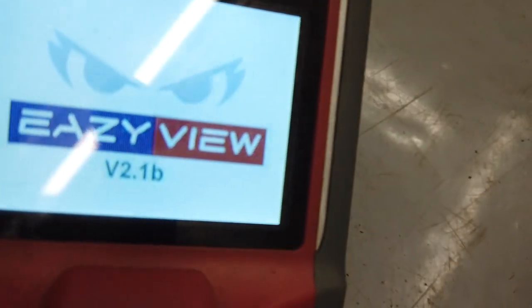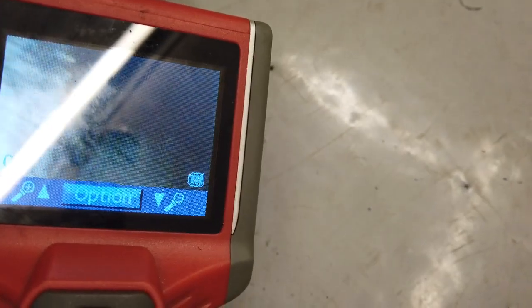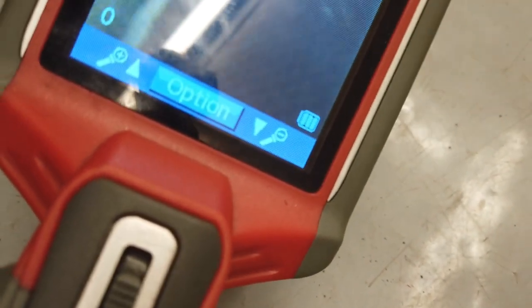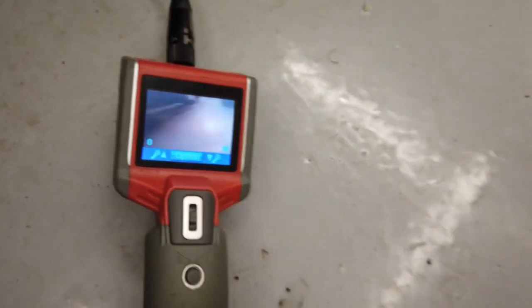Up to the top, sort of got a surface rust on it now. Well known for condensating in these sections. Hold on, I'll repower that up. Get that on again, just clean the end of the lens. In we go. It's on the top edge of the inner sill there. That's all good. The outer sill's pretty good, to be fair, there's no rust coming back. So keeping it dry and then that on it means it's just ready for another blast through of Dinitrol, but it's not got any signs of rust coming through. You can tell that anyway, nothing's creeping through.